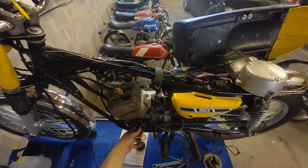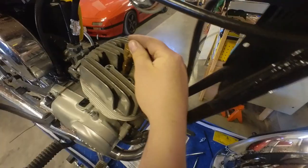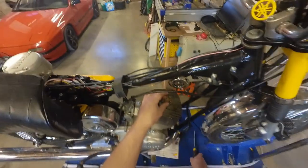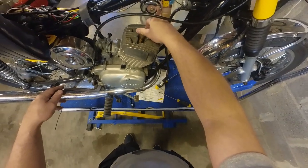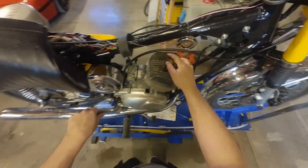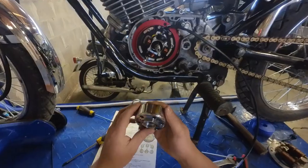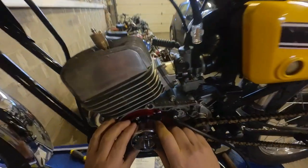Now the moment of truth. We have to put the engine at two millimeters before top dead center. So we have this spark plug micrometer here - let's put this thing at zero and now we rotate the engine. There we go, that's all the way up - that's top dead center. Let's rotate the engine further and now we screw this thing in two millimeters - one rotation should be one millimeter. That is two millimeters. Now we slowly rotate the engine until the piston hits the little tab - click. Now we have to align the marking on the rotor with the marking on the stator, like this.